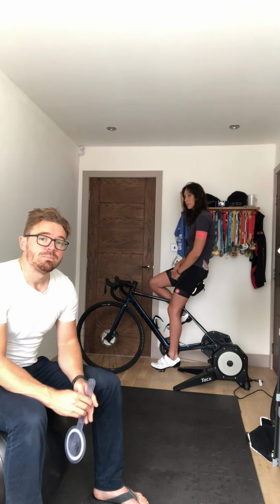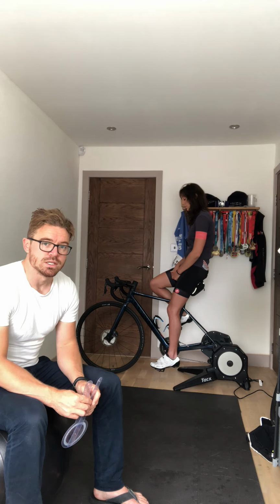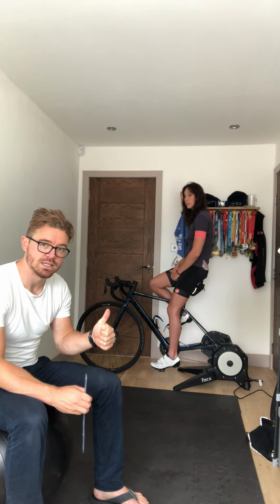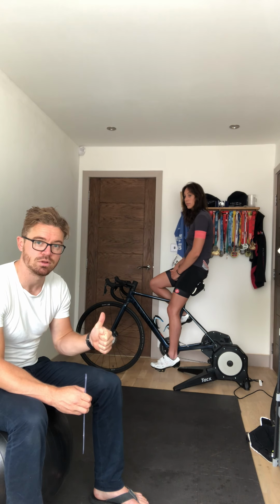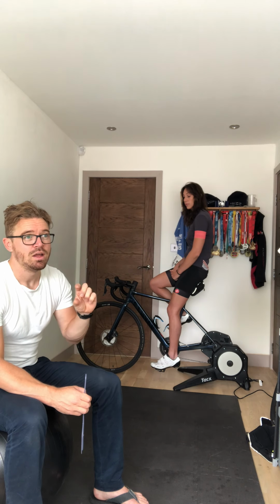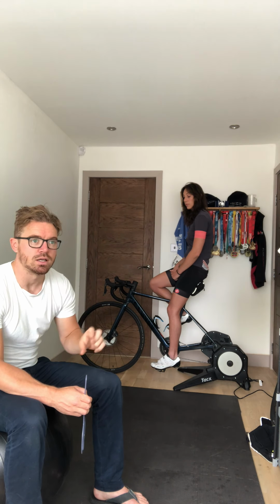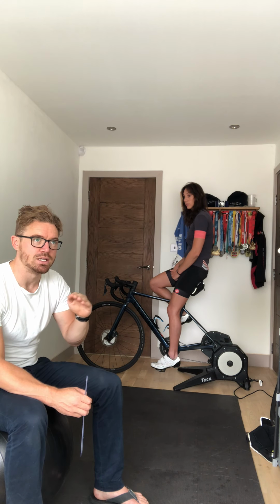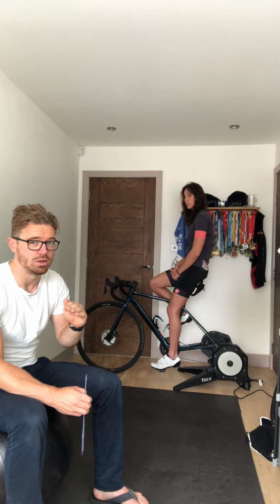So in summary, there are 3 major points that you should look at when setting up your bike if you're doing it yourself. Number 1, bottom dead center position, 30 to 35 degrees knee bend. Make sure it's in that position, it's infinitely better. For those, again, experienced cyclists that are watching this, yes, you can come a bit lower and you will see professionals edging into sort of 28. Lowest that you go is 25 degrees.